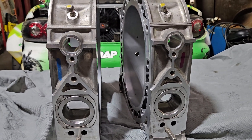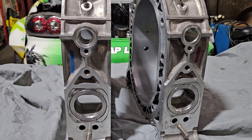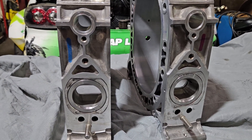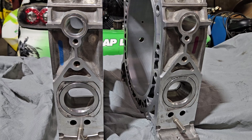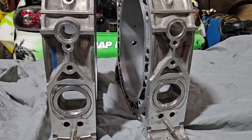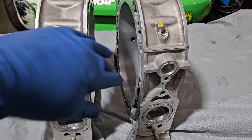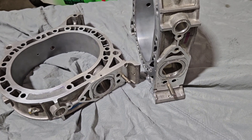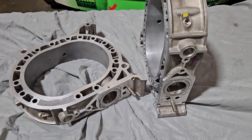For street driving this is a little excessive. Even in drifting, with a 13B, you start to have to really keep it high in the RPM. I could see this combination working great for a 1,000-plus to 1,400-horsepower four-rotor, or getting into multi-rotor combinations. I think my preferable setup for most 13Bs and three rotors is still street port half bridge, because we maintain some of that bottom end. But it's amazing what rotary performance has been able to do with this type of combination. We could easily put a billet block behind this with a center bearing aftermarket shaft, take these things to 11,000 RPM, and probably easily generate over 1,000 horsepower.